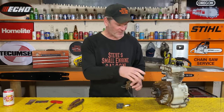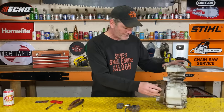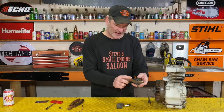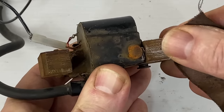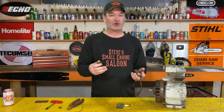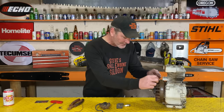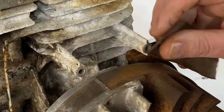There are a few things to know here. First, with a little sandpaper I'm going to sand off the rust on the flywheel, and also on the new ignition module - the little legs down here that get really close to the flywheel. Use sandpaper, emery cloth, or a wire wheel to get the rust off the bottom of those pegs - some people call them legs. While you've got that sandpaper in hand, I also want you to take the sandpaper and polish the two pegs where your coil attaches.